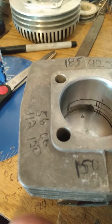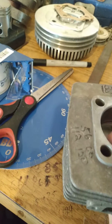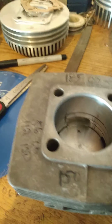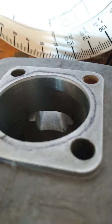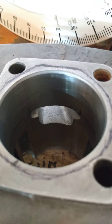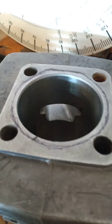These little motors come with super low exhaust ports, super low transfers, and super low blowdown, so I'm guessing all that material is so it can flush out the cylinder and scavenge properly. I prefer to stay above my blowdown line. My bottom corners are right at the transfer opening. I don't like to create a lot of port area below the blowdown line — to me it's kind of wasting space.